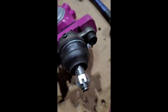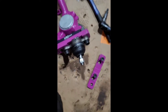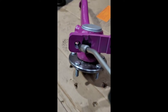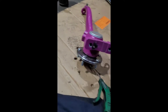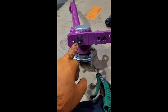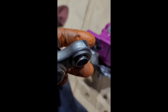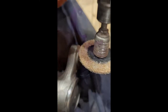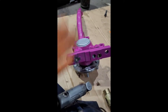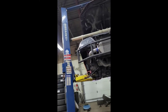Now assembling the spindle. Make sure you clean them out — shrapnel left in there will cause you to misthread and kill your threads, so blow it out. I tried fitting it and it doesn't want to fit. I have to put a little taper — basically just bevel the edge — on the dowels so they slide in. Literally updating you on everything so you're not like me, stuck with no videos, no instructions, nothing.